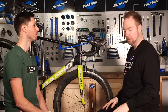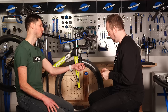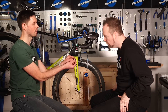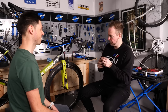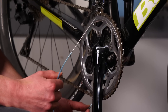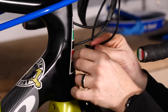Where's the part I told you not to lose? The cable end stop — it's important to put this on the correct way round. This section needs to go so that the open end goes on first, because that is what it sits into. If you put it on the wrong way round, the housing can't sit into it. Cable in there, all the way through — it'll poke out the bottom. The guide will go back into the frame.